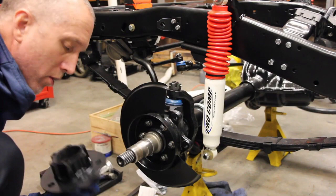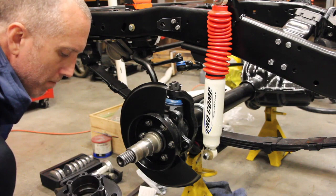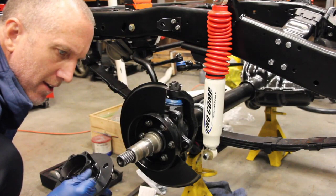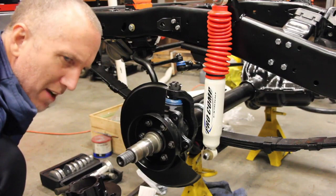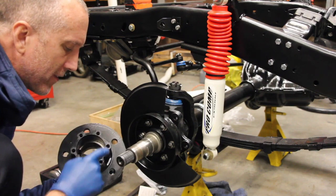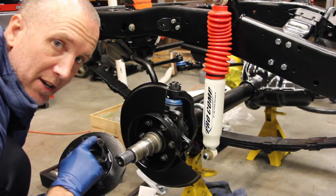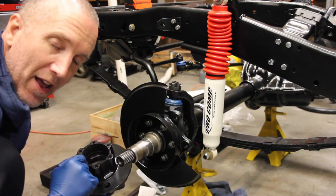Now that the dust shield is on, the next thing to apply is the wheel hub. There are two different stock versions: the 6-bolt and the 5-bolt — this refers to the locking hub, not the lug nuts. From 1976 to 1981, they had the 6-bolt locking hubs; in 1982 they switched to the 5-bolt locking hub. I've got the 6-bolt Warn premium locking hub for this 79, and you can watch how I restored it in another one of my videos.